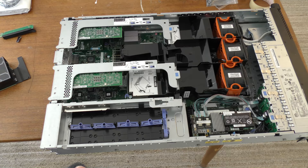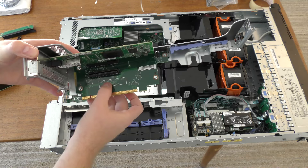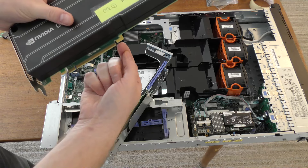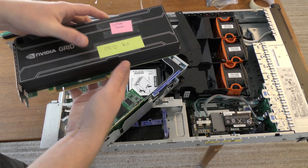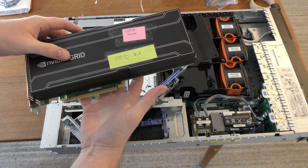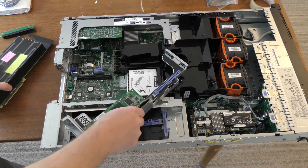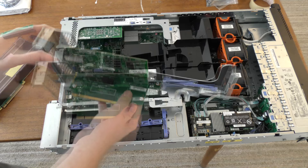That comes with a lot of problems — I've done this before in other videos. The biggest challenge with this server is that the riser cards only come with an x8 slot, and the graphics card is an x16. You can actually cut off the end to make it only x8 and plug it in — it will work, but it won't have full performance. I've done this down to an x1 before and it didn't hurt that much. Instead of cutting the card, I've modified the socket so the card just reaches out of it, and I'm going to do that again today.